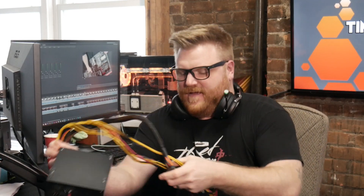Editing TJ here — Timmy Joe for short. Do you see what was wrong? I didn't see it when I was taking it apart, and I'm so dumb — it's so obvious. That rat's nest of power supply cables just hanging out in the bottom of the case — he had the little floppy drive connector, that's still included on budget power supplies for some reason, connected to a fan header on the motherboard. No wonder it was triggering over-current protection.